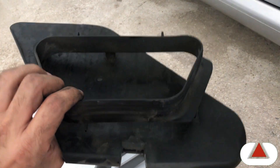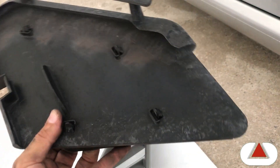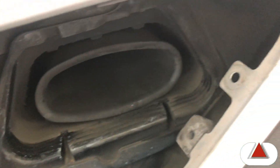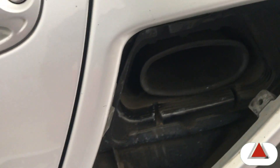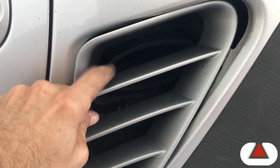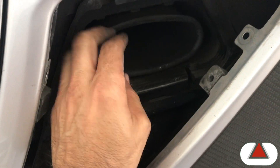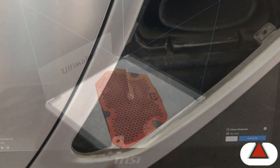This is basically what the guys remove for the de-snorkeling mod. The whole idea is that this cover is restricting full airflow into that piece over there. So you remove it and put the grill back in, and cover it with something — I'm trying to do a mesh in here just to avoid anything going in there. It should sound different, though they say that for this specific car it doesn't sound all that different.